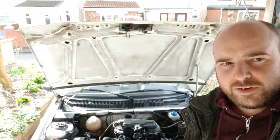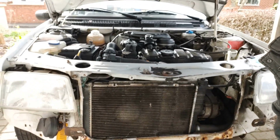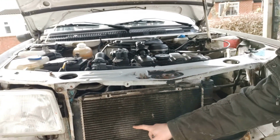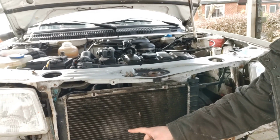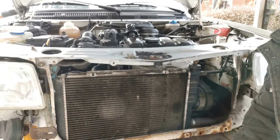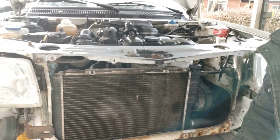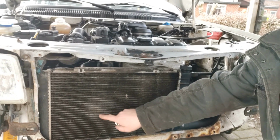And so what I want to do now is just jump straight into the middle of a car with no front end. This kind of escalated. I've skipped a lot. It's going to be pretty clear when we come down. The fan seized. It's come off. I'll show you in a minute. I basically can't find an original piece. I've put an aftermarket one in, but it fits pretty nicely in the original casing. So step one is that it looks like it's overheated or something here.